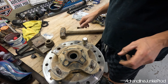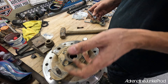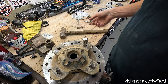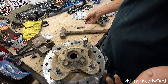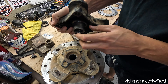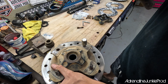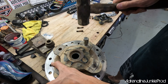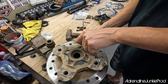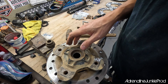You don't really need to put a lug nut on here if you're redoing your studs. I got seven years out of these original studs — I might as well replace them. I've had wheels off and on this machine hundreds of times and I'm sure those threads aren't as happy as they used to be. I got these from Polaris, but you could basically use any M12 by 1.5 stud. I'm going to save the old studs — I'll throw them in the trailer in case someone breaks a stud out on the trails.